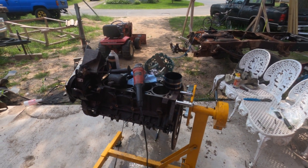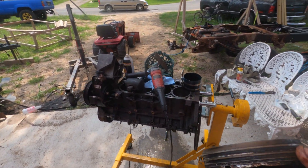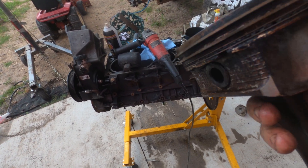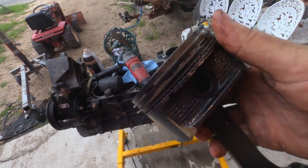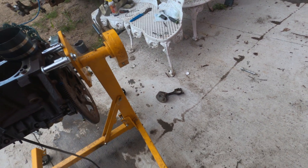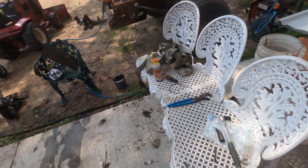We've run into the first fly in the ointment in this build. On this second ring, I can move it around - your rings should be able to move pretty freely, which was the point of degreasing them. It's also why lining up the gaps is not all that critical because they spin in the bores. This one can move, but that one couldn't, and I tried to pry it out carefully - you can stick the end in and work it loose, clean the land out - but it didn't work out. It broke. So I'm going to check what eBay wants for a cheap set of rings - just one piston's worth - and replace just that ring.